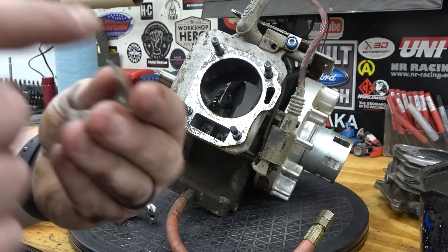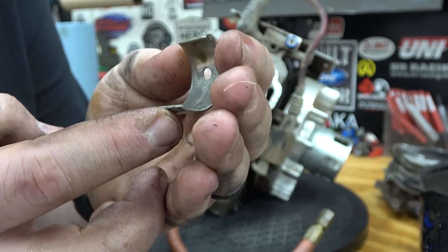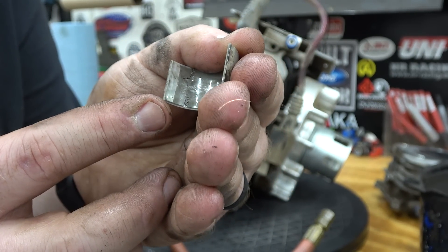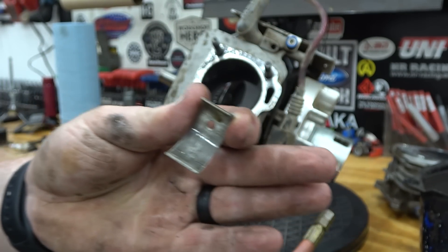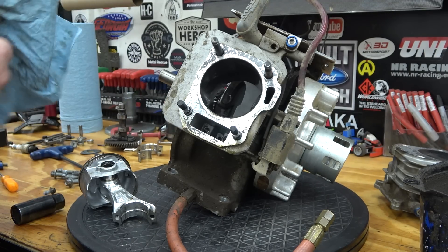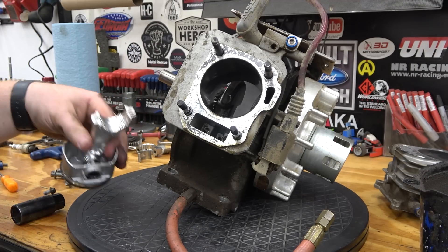Oh no — we had massive failure. There are chunks out of this. I've never seen a bearing wear like that. It was definitely time. I'm wondering what the crankshaft looks like now. You can see that scoring — that's pretty crazy. It's a keeper for sure. The one on the rod cap looks perfect though. There are chunks missing out of it down there. Definitely time.